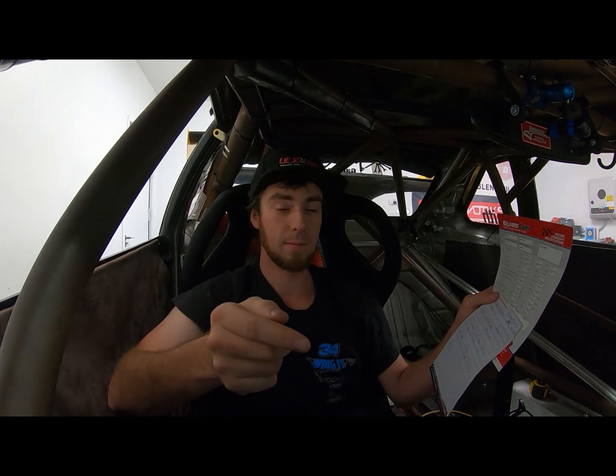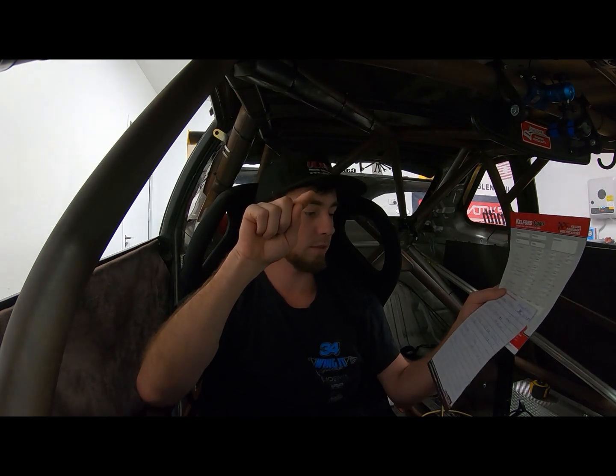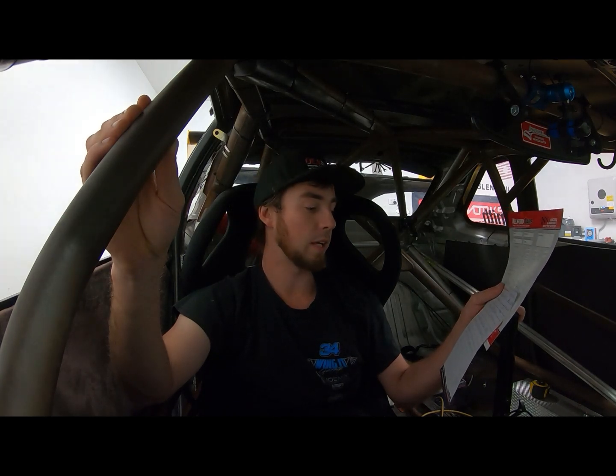In amongst that, there's a whole heap of math. You do your 50.5 plus 180, and that'll take you from the before bottom dead center mark, if you've got a circle, around the top, which for us was 230.5. Then you've got to take away your 1.5, which is where it was closing, divided by 2. You get a number, and then it's a long process. Inevitably, the first time I did it, I ended up going the wrong way on the gear, so we wound it over the wrong way, but we ended up getting to our 116 degrees for our cam center line.